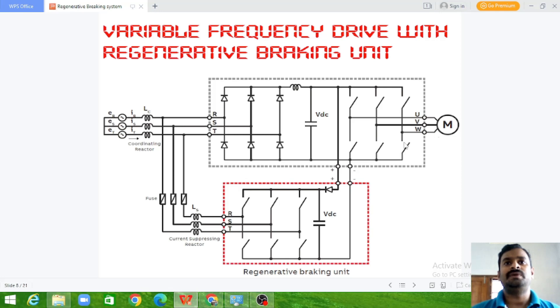When you want to apply the brake, the switching process is given to the regenerative braking unit. The supply comes from the motor — the motor now acts as a generator. The energy produced by the generator is fed to the AC to DC converter unit, which feeds it back to the source or to the battery unit. This is a sample circuit for understanding how the process takes place; the exact circuit used in EVs will be shown separately.